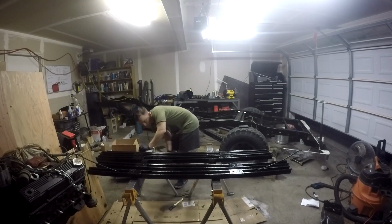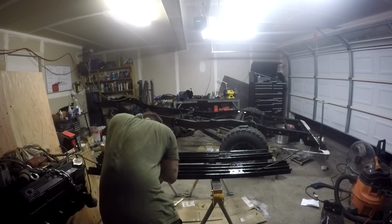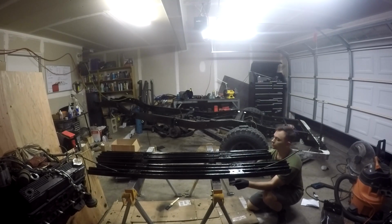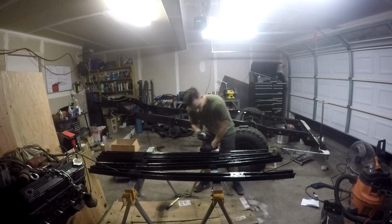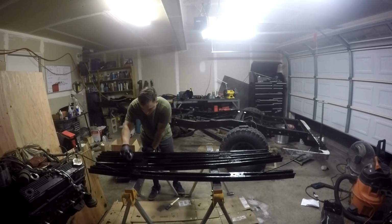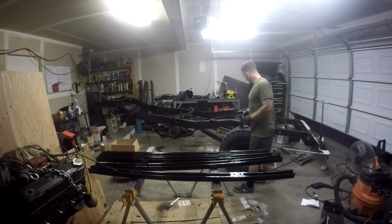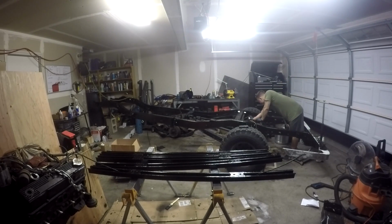Okay, so here I am using a spray paint to try and get into some of those smaller crevices and spots that I couldn't normally reach with a paintbrush. Now, I feel that this is okay in this certain situation because I don't need that hard POR in some of those smaller cracks. Yes, I would love it there, but realistically, I'm going to spend a lot of extra time trying to get it up into some of those smaller areas, and they're really not going to get affected by elements or by weather or scratching or anything that would cause me concern.